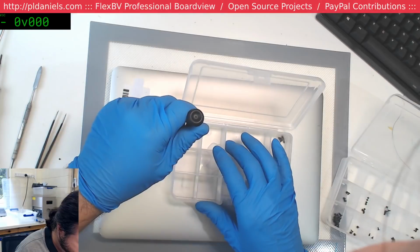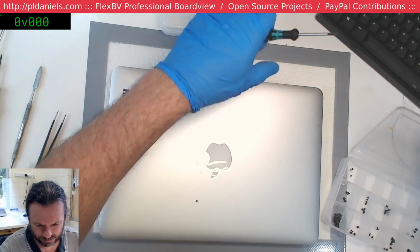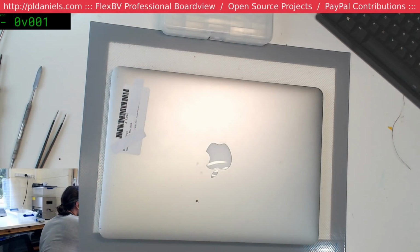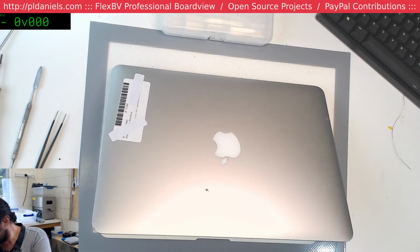A1502 touchpad metal bracket screws. Right, A1502. Bad corrosion. Naked SSD, bad corrosion. LVDS connector replaced. Bunch of stuff replaced. Keyboard backlight connector removed. Replaced a few other parts around it. C2605 has Shrek babies on it. Okay, green snot.